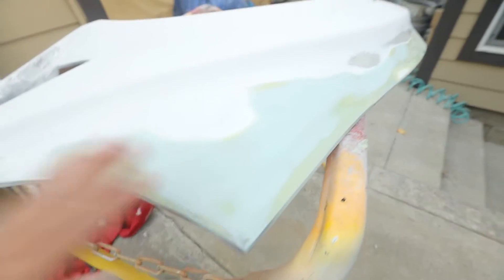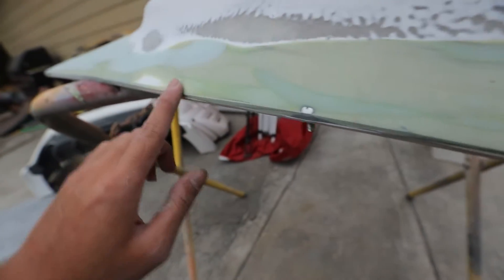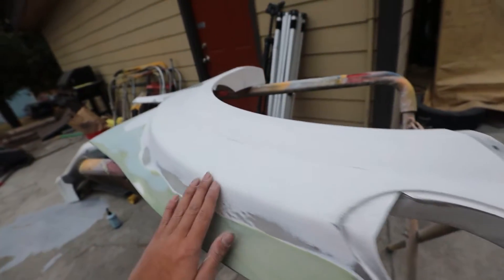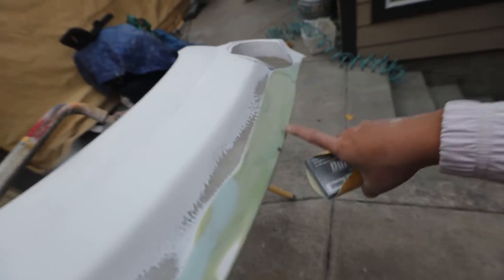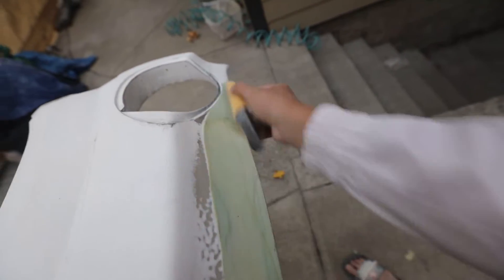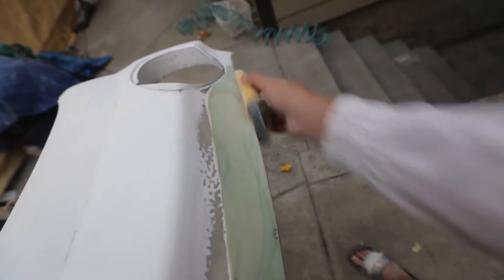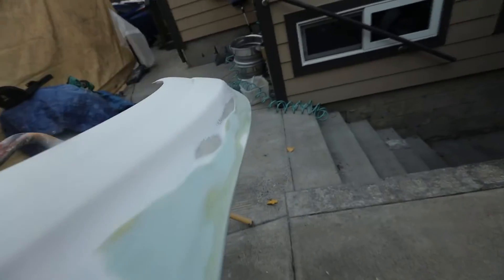I just wrapped up the body work on the panel — look at that, super clean, everything is seamless. The one thing left is that the material we added has a little sharp edge, and the rest of the kit is pretty sleek with rounded edges. So now we're going to level in these edges using sandpaper — take the sandpaper with the block and round out all the edges so it looks factory. Use half-circle motions to get a nice even arc. I'm using 180 grit — you don't want it too aggressive or you might shave through too much and have to add more material.